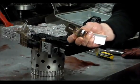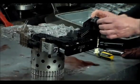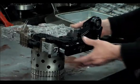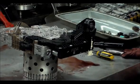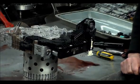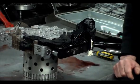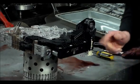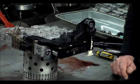I'm also going to be changing the bridge seal and the mechatronic sleeve — the pass-through sleeve, the one that always leaks on the 6HP 26s and 19s. Again, we have a 2013 Ford F-150 with a 5.0, and the reason why we changed out this lead frame is because of a P0720 output speed sensor, which puts the car into fail-safe. There is actually a TSB on it, and this should fix it up.